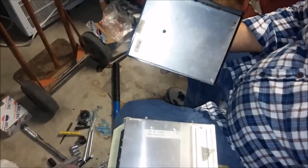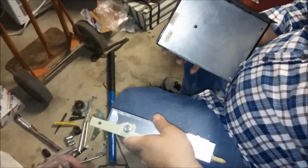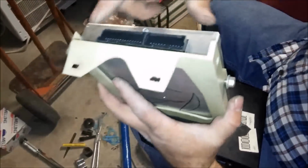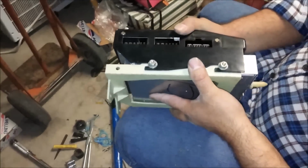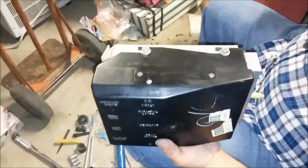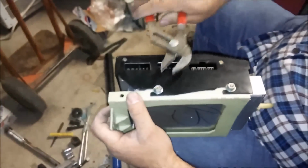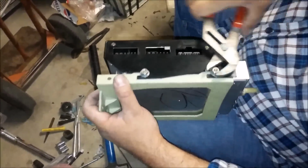You go ahead and put them in. Okay, now we are going to go ahead and put the flashing portion of the relays, which is this box here, onto the brain. So the way that is put on is that if you look at your connectors here, as you can see all these here, you will also see connectors on this side. So what you want to do is push these down into place, slide it, and then tighten these down. And if you have the right tools, it'd be better, but if you got nothing but, like I have, channel locks, just give it a little bit of a snug. Not too much, because of course these vehicles are old and the plastics tend to get brittle. And just give a little bit of a tug, make sure they don't get loose anymore.